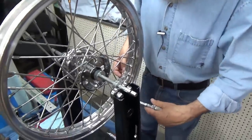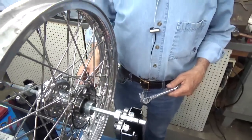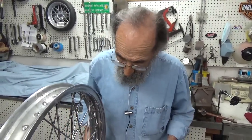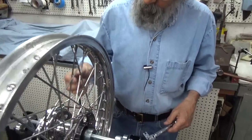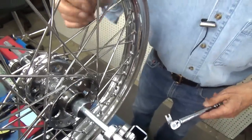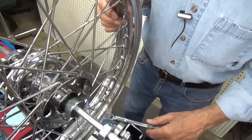What I'm going to do is torque one set of spokes. Now, I'll be honest — I've already torqued it. The wheel is true and everything is fine, but I wanted to demonstrate actually torquing it. Right now I'm torquing it at 50 inch-pounds, which is correct for what I'm doing. This is a front wheel with standard polished stainless steel spokes — it's not like a rear wheel with 140 foot-pounds of torque going to it at the drags, which would be another thing.